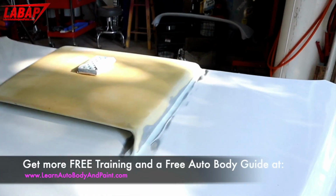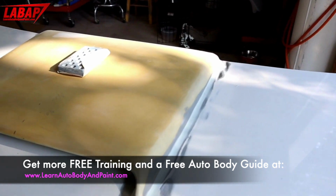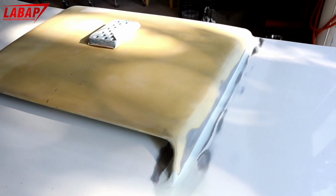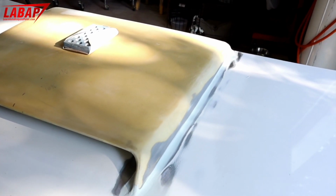Now, when doing custom work like this, you're going to go over with Bondo at least 4 passes, sometimes 6, sometimes up to 8 passes, because you're trying to get the shape right. All right, so if we look in here, you can see it needs a little bit of filler in those dark areas there. You see it?